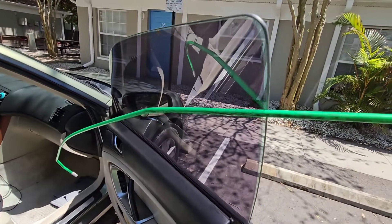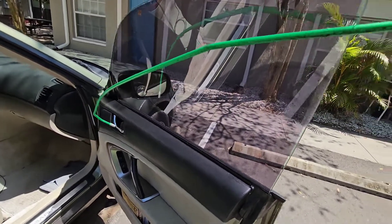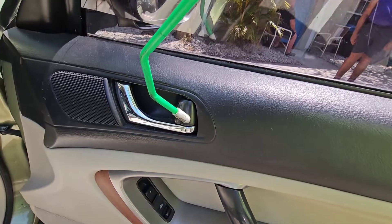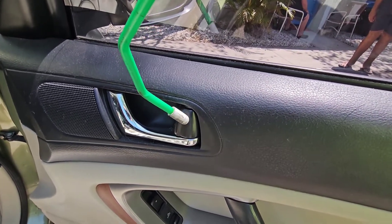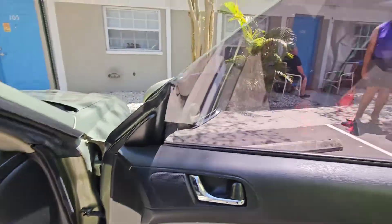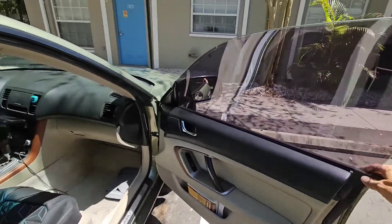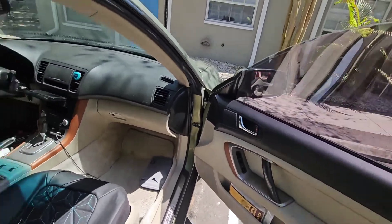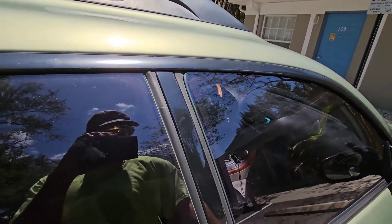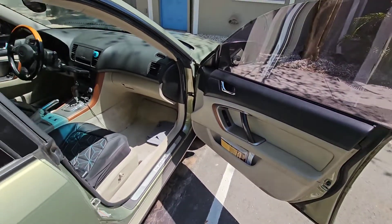If you make your own tool, make sure you coat it very well, because any bare metal rubbing against your glass is liable to break it. That's why it's important to put tape on the end if you make it yourself — you need some friction against the plastic to push the flipper lock forward. Just get it on that little flipper lock and push it forward, and that will unlock it. When you shut the door, the glass goes right back to where it should be with no chips or damage to the door panel.